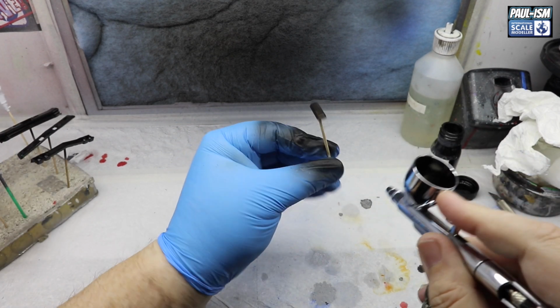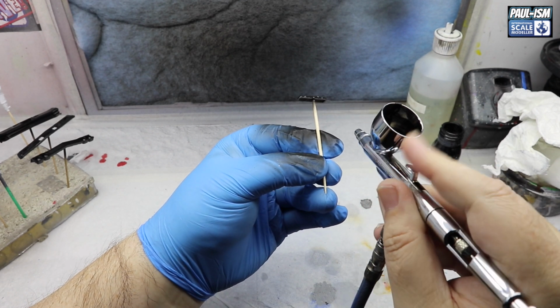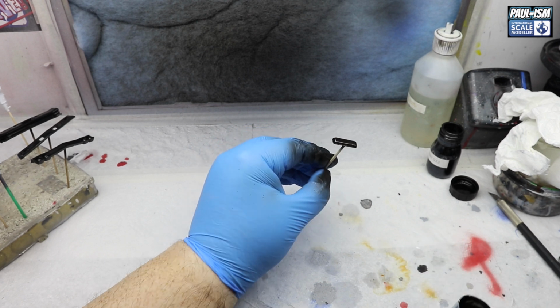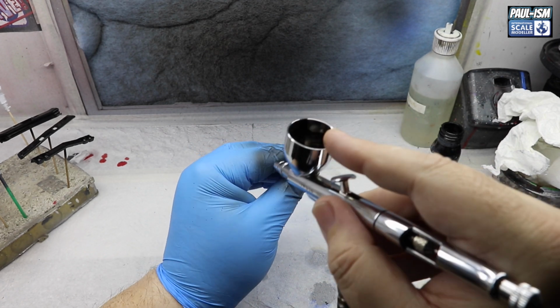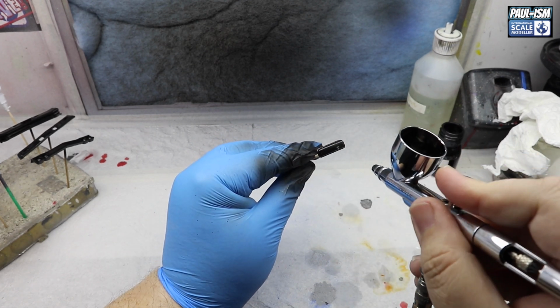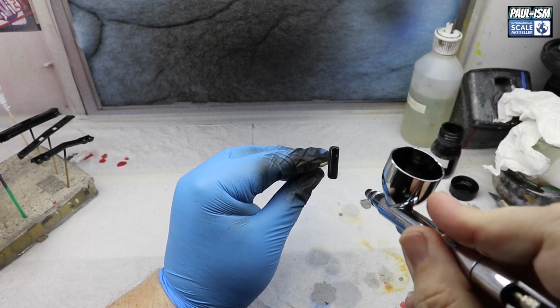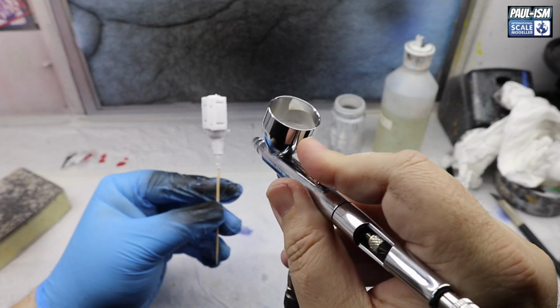Same on the cylinder, the cam covers, I call them, valve covers, wherever you call them, where you're from. Just put a coat down, leave it for a minute or two to flash off, and then come back with two or three coats, wherever you think it needs. As long as you've got a nice orange peel free finish at the end, you're good to go.